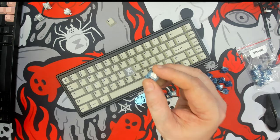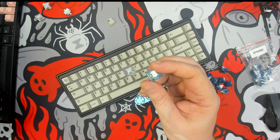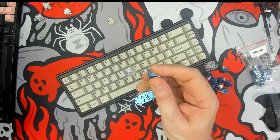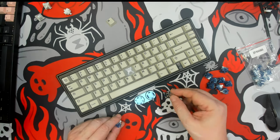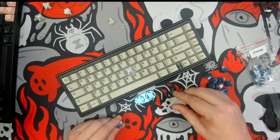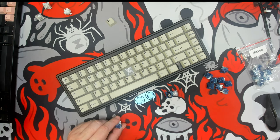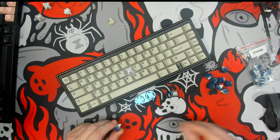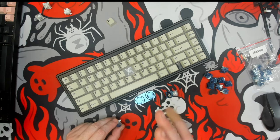This is made from a PC top housing, a specially modified nylon bottom housing, a POM stem, and it does have a selected long spring. I'm not sure what 'selected long spring' means, but that's what it says. It has an operating force of 46 grams plus or minus 5 grams.